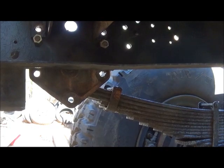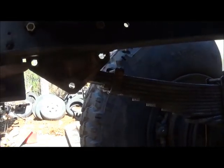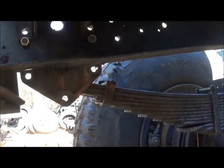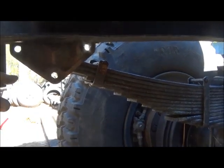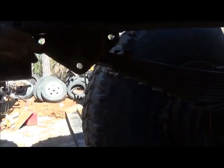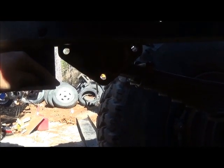Okay folks, back up working on the front side. This plate right here is separate — I don't mind bolting or welding to it, it's already got a few holes in it. But I don't want to weld or bolt to the mainframe unless I bolt into the side of it. You don't ever want to bolt into the flanges on top and bottom. I'm gonna take another piece of truck frame — it's heavy stuff, quarter inch, actually much heavier than this — and bring it down, then run it up inside here and bolt it in with three bolts.